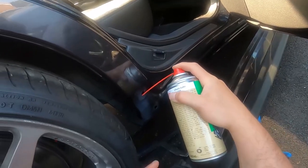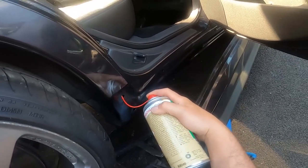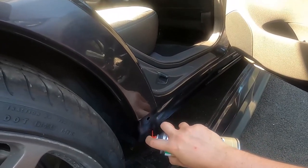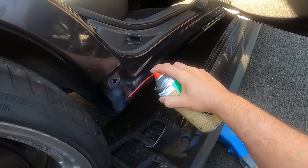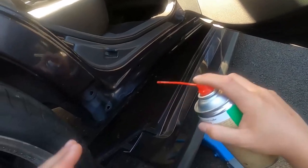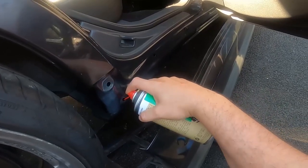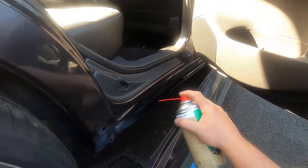There are definitely cheap ways. Check this out - even our painting and decorating. Just go fill that cavity - spray and pray, you know how we roll. Like I say, you could probably use cheaper stuff like Waxoyl - a massive five liter for like 25 quid. Be lucky if you get two cans of this for 25 quid. It's dripping out the hole in the bottom there, so that means we've put enough. I'd rather be overly cautious with it - it doesn't bother me.